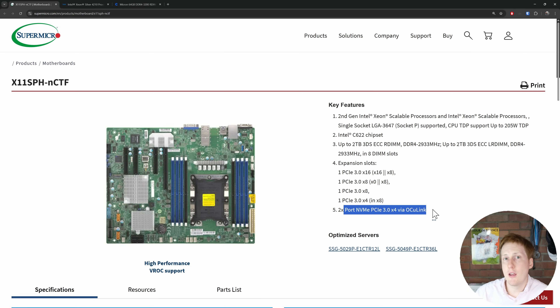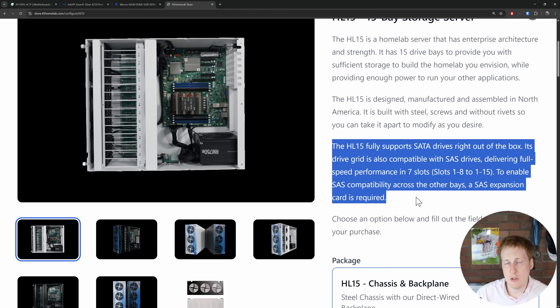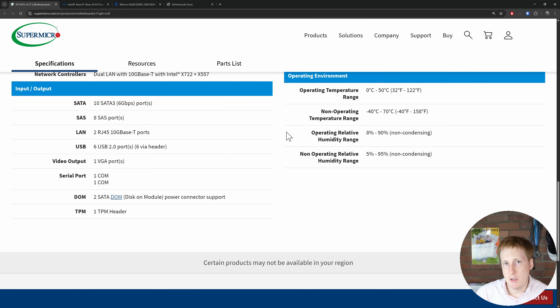You can basically plug in anything here that supports PCIe — it could be additional NVMe lanes, or it could even be GPUs. In terms of scalability, you can get this up to 28 cores with even the CPU they ship with. The device comes with a single M.2 drive populated with their Rocky Linux Houston OS, which we'll dive into in a moment. If you wanted to add more, you're probably going to need an expansion card or use the Oculink ports, though you'll need some sort of adapter so the NVMe drives will fit.